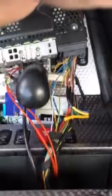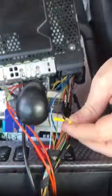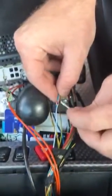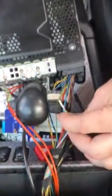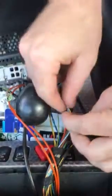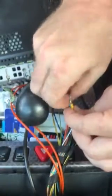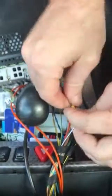Once I make this connection I should get some sound. I don't personally like to use butt connectors; I at least do military splicing. I don't have any solder with me at the moment, but at least doing some military splicing. As you can hear, the sound kicked on as soon as I shot voltage to this wire. I'll go over the relay configuration — maybe it'll help somebody out. Bear with me one second while I tape this connection up.